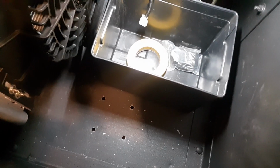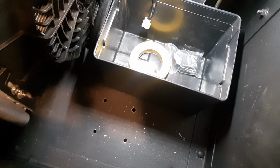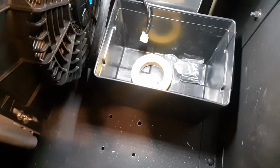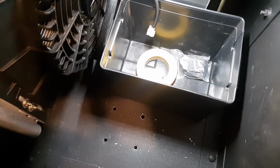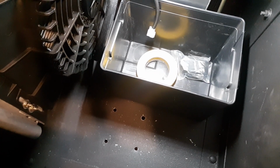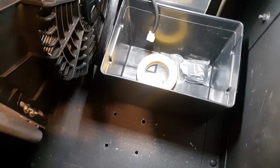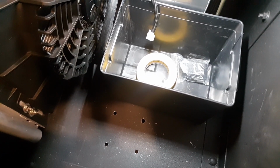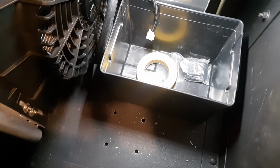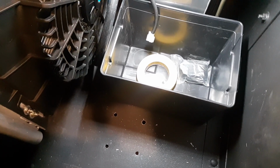Because I'm not going to put this on the ignition switch, I think. You'll be able to turn it on if the truck isn't running, but then it'll probably suck all the battery juice out of the battery if it runs. So technically it should be on the ignition switch, so you can't turn the damn thing on unless the ignition is on, so the alternator can repower the battery. But whatever, it's your decision, not mine to make on your vehicle. But anyway, let's leave it as that for now.